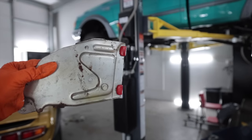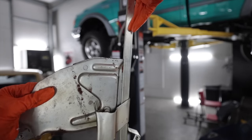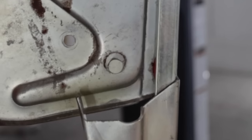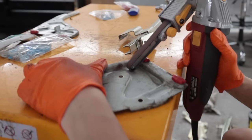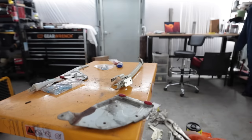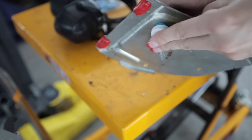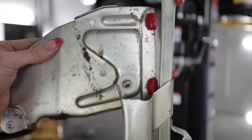This attaches to the glass. This is sitting inside the door. This slides inside here. But if you see, there's a wheel missing. I love it when people come up with creative solutions using other things to fix problems, like using a nutsert as essentially an axle for a plastic wheel to roll on. However, I could see if you over-tightened these, you would make it swell and cause that little plastic wheel to stick. All right, now, test it.